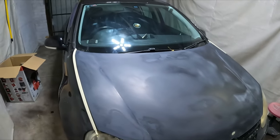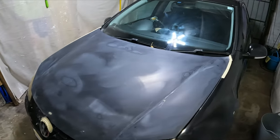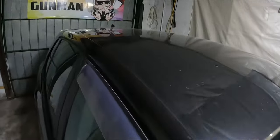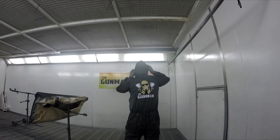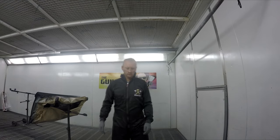That's it for one session — it's probably been about two hours. I haven't been busting a gut today, but just thought I'd give you guys a look at the progress. We got the bonnet sanded down, got the parts taken off, did the spectro reading, did that little repair that needed two skims of UV filler, and there was also that little bit of damage up top — all sanded out and scuffed down, ready for mask and prime. I'll see you in the next one. Big thanks to everyone for watching — if you'd like to support the channel, check out the merchandise: Colad-branded spray suits with a Gunman logo, plus hats, drink coolers, hoodies and t-shirts. Check the link in the description.